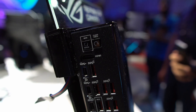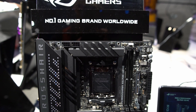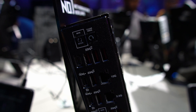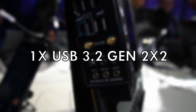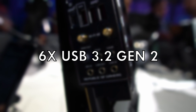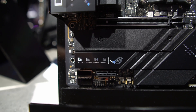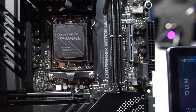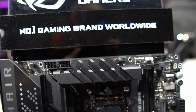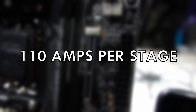Despite its smaller size, the Gene has a decent three M.2 slots — one PCIe Gen 4 and two Gen 5. Gen 5 support also extends to the shielded PCIe x16 slot, so future GPUs are fully covered. Connectivity sees no compromise given the board's size: dual USB 4, a single USB 3.2 Gen 2x2, six USB 3.2 Gen 2, two USB 3.2 Gen 1, and six USB 2.0. Internet access is Wi-Fi 6E and an Intel-controlled 2.5G LAN. Power delivery is a 16+2 phase design rated at 110 amps per stage — more than enough for this size of board, especially for hardcore overclocking.